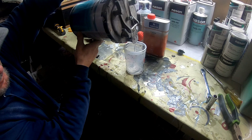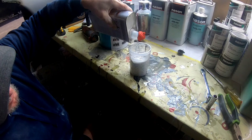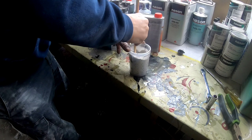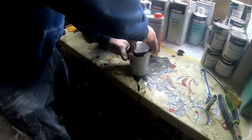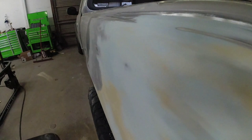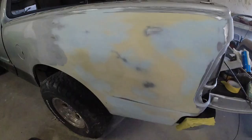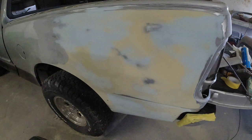You can reduce this primer, but I opted to use it at full strength because we do have some blocking that needs to be done — we have a large area of body filler, so we need good thick material on there to block it straight. Now we have this ready for primer. Let's take a good look: nice and straight, with a couple of bare metal spots showing through, but we're using a direct-to-metal primer, so let's tape this off and get it primed.